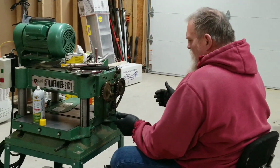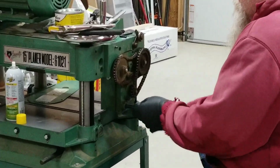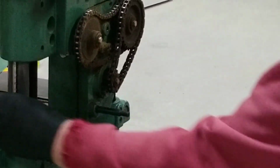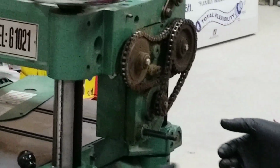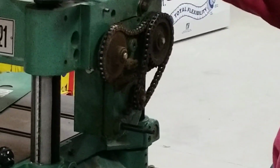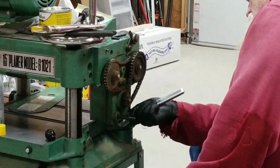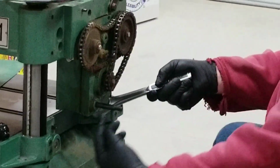So the first thing we want to do is unscrew the knob. Get this off, so that when you break the seal, it slides off the shaft. The shaft, if you look in your manual, if you still have it, shows that it's bolted from the other side, so this should slide over. The second thing we want to do now that we took that off, just to get out of the way, is to crack the oil release nut, and that's on this side on the bottom.